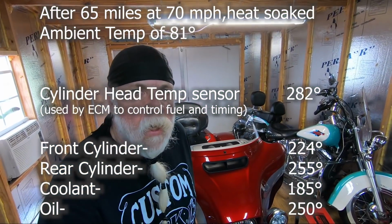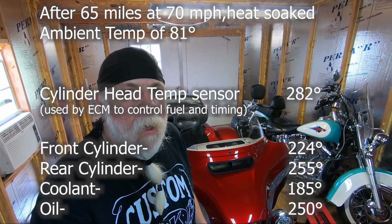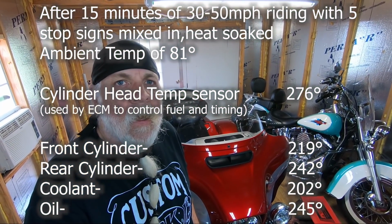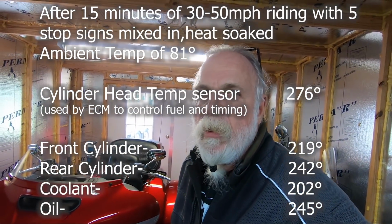Okay, we're back from our second run with the tank lift. Temperatures are much lower, recorded them all. Going to quick put the cooling deflector wings on and go out for the last run of the day. It's important that I do this all in the same day, same wind, same ambient temperatures, all the conditions the same, for it to be an apples to apples comparison.